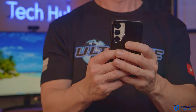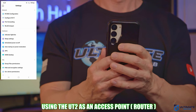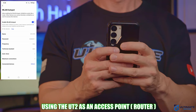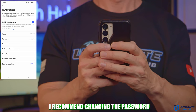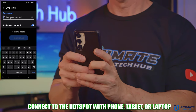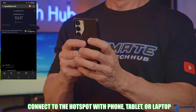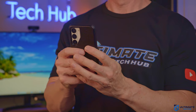One of the cool things about the UT2 is that it can become a router using the hotspot functionality. Go into Settings, then Network Settings, then WLAN Settings, and enable hotspot. From here you can see and change the network name and password. Then go into your phone's Wi-Fi settings and connect to the hotspot. We did a speed test and the download speed was very fast. One thing to note: turn off the hotspot when it's not in use, because it can be a security issue.